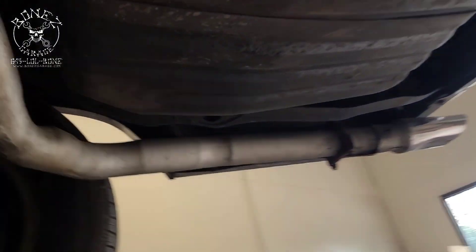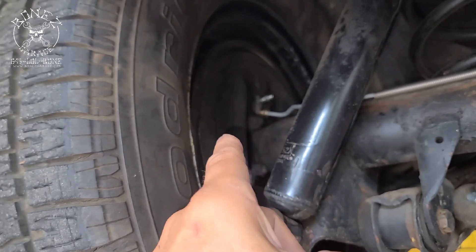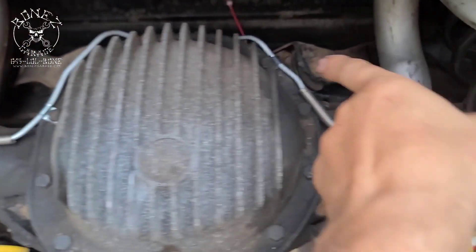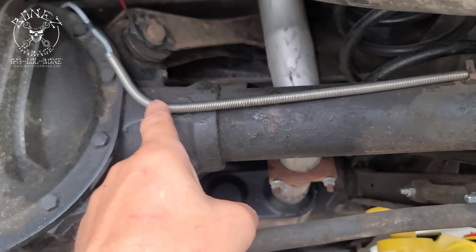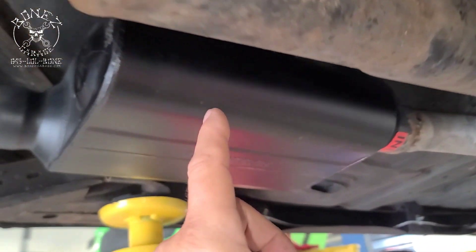There's a new center brake line for the rear differential, and you can see the brake line runs beautifully right where it's supposed to. All new brake lines to the rear, all new shoes and springs, new wheel cylinders — everything is nice, clipped and armored the way it's supposed to be. The brake lines came out beautiful on this car.